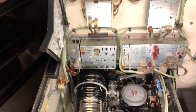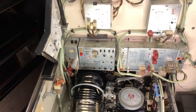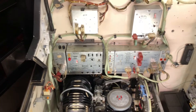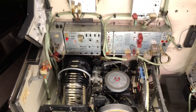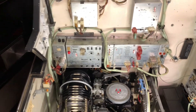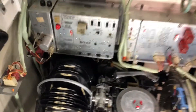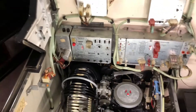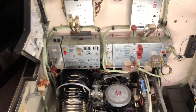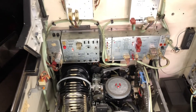Let's go to the troubleshooting part now and talk about the amplifier or sound problem first. You put all your components back in your jukebox, you put everything in correctly, you've made sure your plugs were snug and secure, you plug in the box, you make a selection, lo and behold it selects, it brings the record out, starts to play, and you have volume only on one channel — one channel is silent. Before you panic and call Bill Beckers, there is one thing you can do: switch from stereo to mono on your amplifier. If the problem corrects itself and you get sound out of both speakers equally, that is actually good news, because that means your problem is up front — either your cartridge, your cartridge wire, or the input cord and plug.